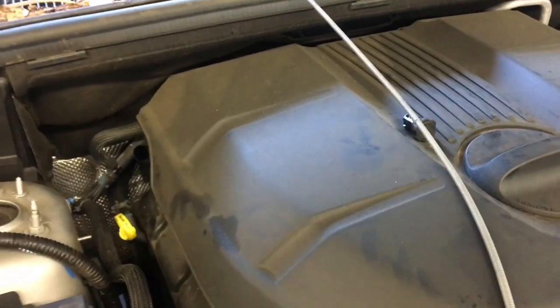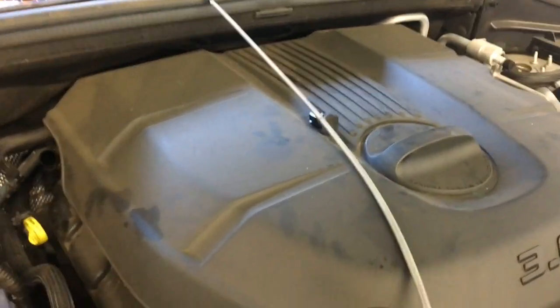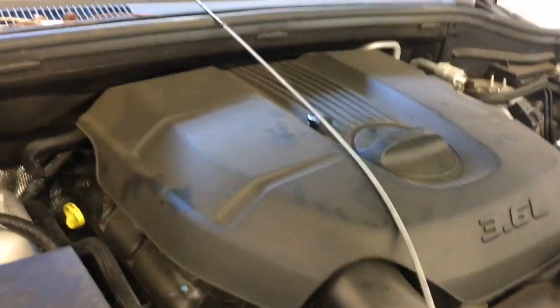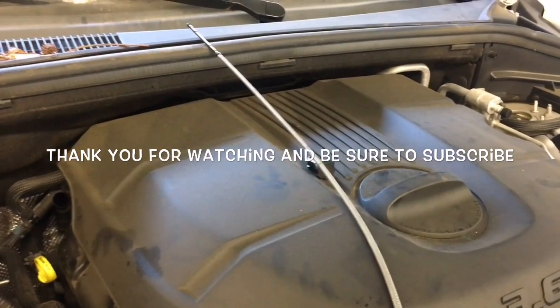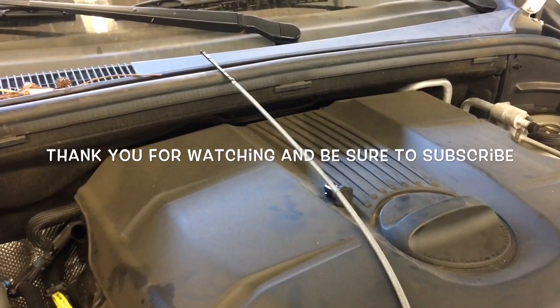After charging your AC, the last step is to check the transmission fluid and top it off. On these cars there's no dipstick, so you need a special tool — basically a universal dipstick made for checking transmission fluid, which you'll have to order. Check it with the engine running at normal operating temperature and shift through all the gears. If you're just doing the condenser, you'll probably only lose a couple of ounces. In my case the transmission was actually leaking, so I may need upward of a quarter quart. That completes the job of replacing the AC condenser slash transmission cooler on a 2011 Dodge Durango. I'm Brian Esser from HowToAutomotive — thanks for watching and please subscribe.